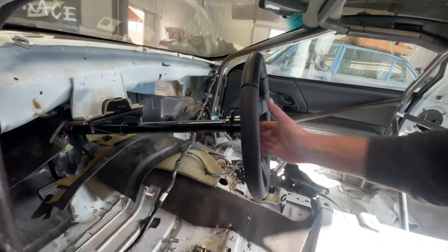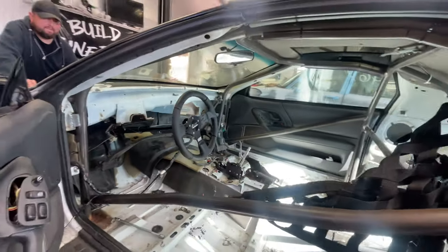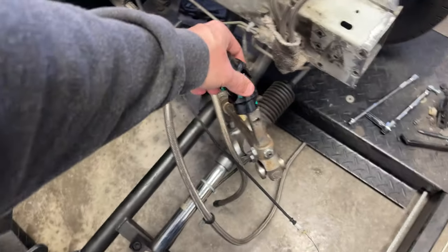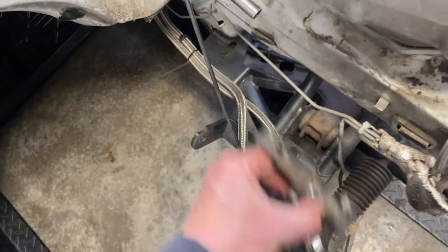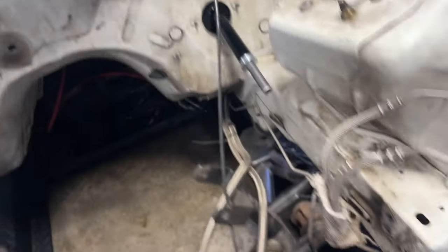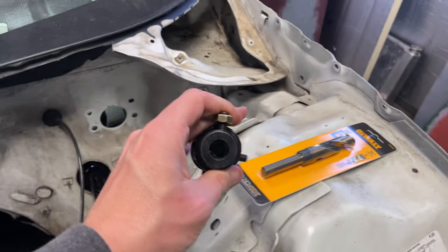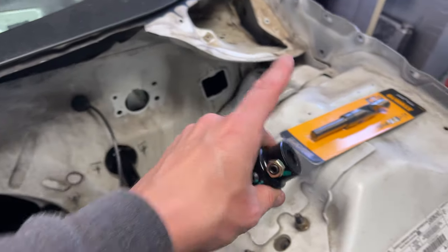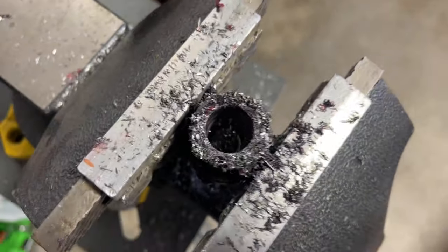Now the quick-release steering wheel that I wanted to add to the Camaro - once we update the cage this will make it easier to get in and out of the car, plus it drops some weight. I found a steering joint from another project that I never used which has the right fit on one side to go onto the shaft, but I need to adapt it to three-quarter round. This side has splines for connecting down below. Going to drill this out - picked up a new $30 drill bit to hog it out so I don't have to order a new one. Now it's three-quarter round instead of spline - perfect.